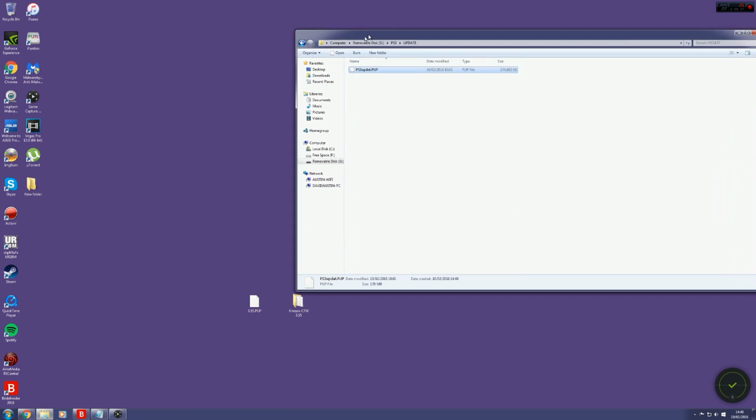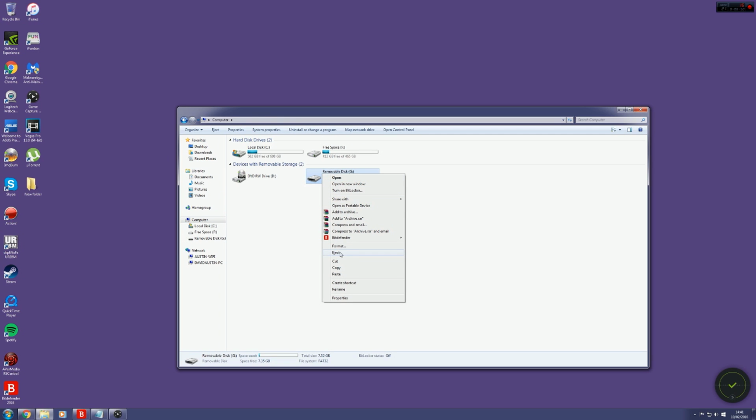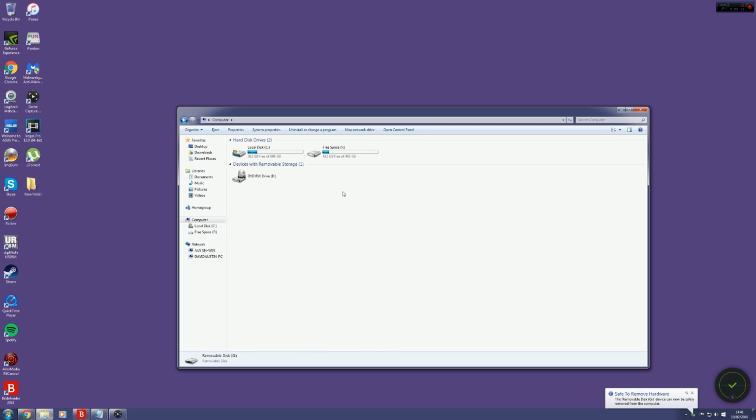Okay, so there we are. You're pretty much done. All you got to do now is rename this to the correct thing. So right click and rename, and you are going to want to rename this all in capital letters as well. PS3, UPDAT, not update, but UPDAT, exactly how I have. Just click enter. So it's PS3UPDAT.PUP. So you're pretty much done now with the memory stick. I'm going to show you how to actually update your system now over on the PS3. So just eject the memory stick, right click and eject the safe way, and now you can unplug it.